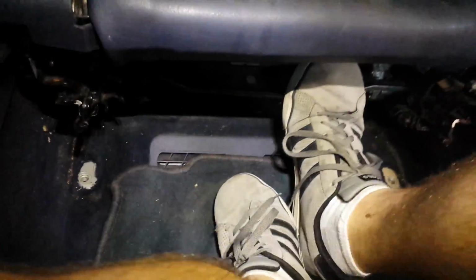Then you can go ahead and slide the seat backwards. This makes it easier to remove. The front is held on with hooks. So get in the back again, push the seat forward with one of your hands or both, and with one or two of your feet, there's going to be a rail underneath it, and push on that. And the seat should come off like that.